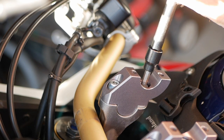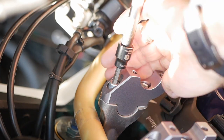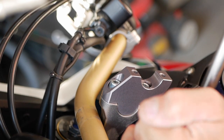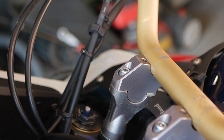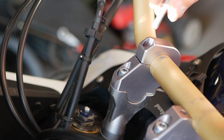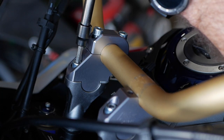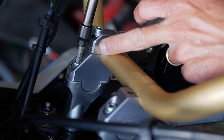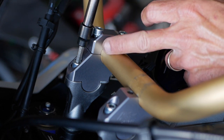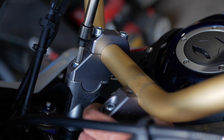So those bolts, they have to be tightened to 20 foot-pound of torque. So you have to torque the clamps. It says between 18 and 20 foot-pounds of torque according to Rox specs. So now I'll be using actually what Rox is specifying, not what it says on the Honda Africa Twin shop manual. And there we go.